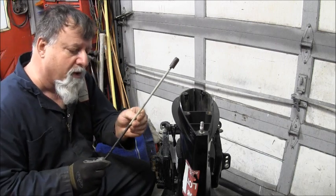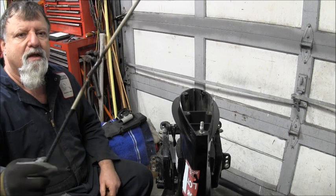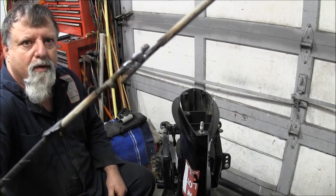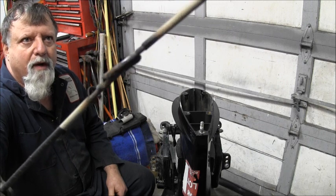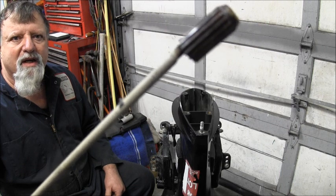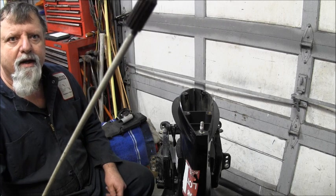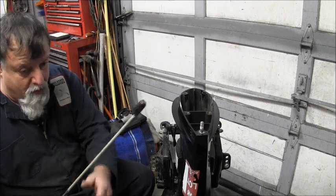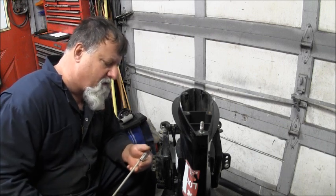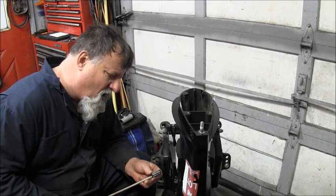I'm getting it off of there slowly. There's where I bubble gummed them all up with my wire welder. Just two welding rods. And then you do what I did with the stinger and it melts it to the drive shaft, and you fish it out of there. And now I'm looking at these splines, and they are not bent at all.